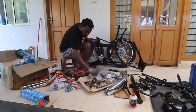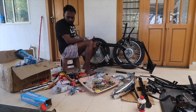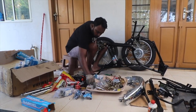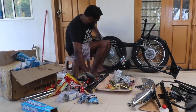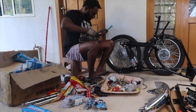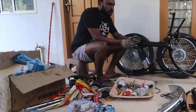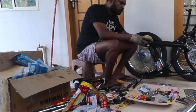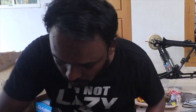Once you have a comprehensive list, see what can be reused or refurbished. For bikes like the Yamaha RX, buying new chrome parts is usually cheaper than re-chroming. Buying a new tank is better than painting your old one, especially if it has rust — even small amounts of rust are terminal. Get all the nuts and bolts zinc-dipped. I recently bought the entire nut and bolt kit for an RX and it was above 4,000 rupees. Getting your stuff zinc-dipped is cheaper than buying locally made alternatives that will affect your overall build quality.